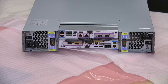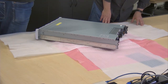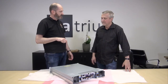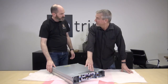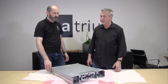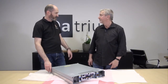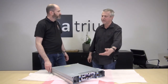We've seen all of the front and the back with lots of network connectivity. Ports for the SFPs for the 25 gig, or RJ45 10 gig, as well as RJ45 1 gig. This can be ordered with a pair of 25 gig SFPs or four 10 gig ports, so we have slightly different options depending on your data center configuration. Those are both basically the same capabilities — same bandwidth available — just different connectors. It doesn't change what's going on inside here, just how it connects.